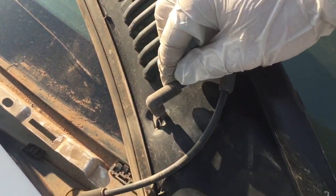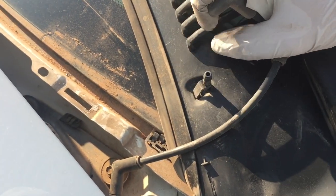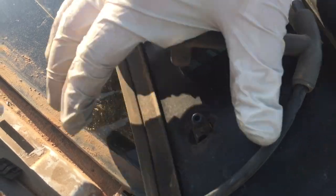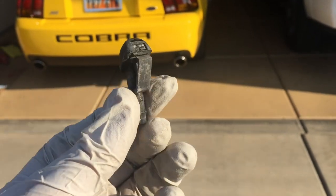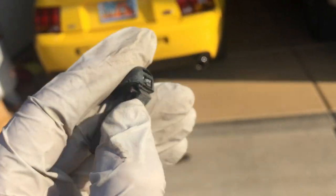On the back side, on the driver side, you'll have another area to pop off. Same thing — push on that tab and push the other nozzle through. Follow the line where it's placed on the bottom side of the cowl and just pop it out. Be careful not to crack it — you can put a screwdriver underneath and gently pry to help get it out. Same thing on the other nozzle — push down on that tab and pop it through the top.